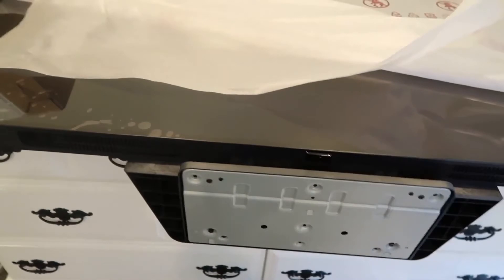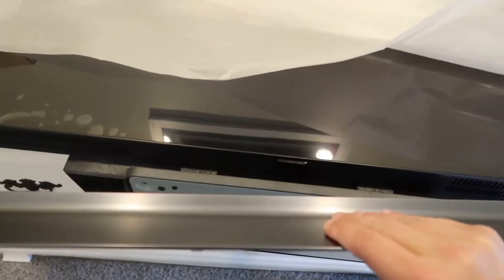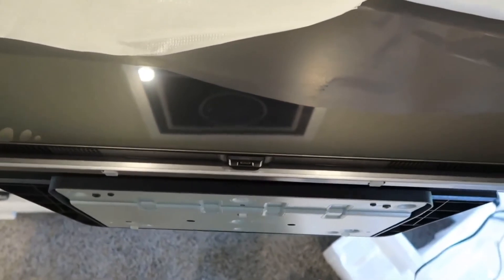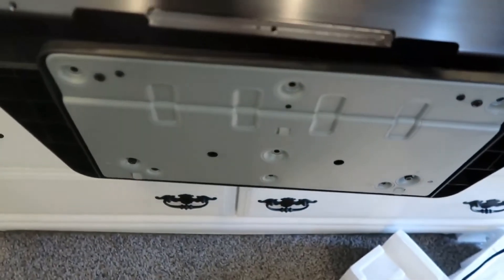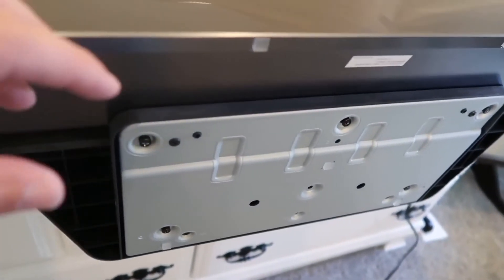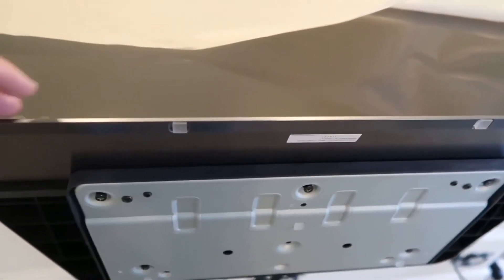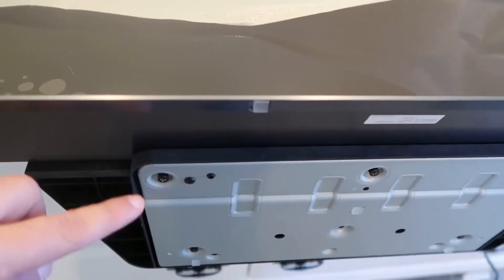Once you have the back base on, in order to keep it stabilized, you've got to put on the metal plate. You angle it and then position it just like that. There are three screw holes here to keep watch on, so you want to align the plate so those three holes match up, then screw your screws in to stabilize that plate. I will be honest — LG did not make that easy. LG, if you watch this, you might want to improve the engineering and make those screws a little bit easier to get in there.